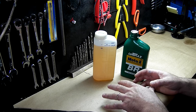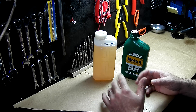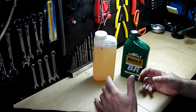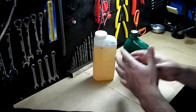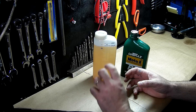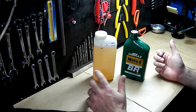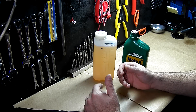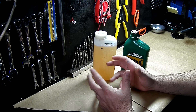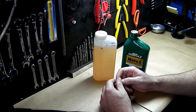So you can end up putting an incorrect oil ratio in your machine, which can lead to metal failure, overheating, and similar problems. We have had cases like that in the shop — people using Stihl oil at the ratio recommended by Stihl, which is a little less oil than what Chinese engines need. I sometimes even wonder if they don't do that on purpose to cause the other brands' engines to fail.